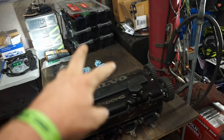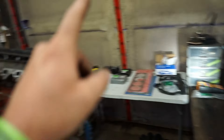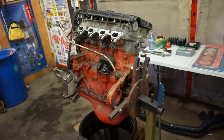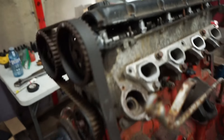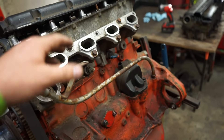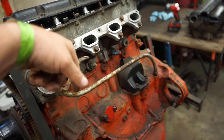I also want to check out the bottom end. I bought these motors as a pair and one of them was locked up solid; this one still turns over fine and seems to have decent compression. I want to check the cylinder walls, check the bearings, and everything else when I swap them. Also going to swap cams - this has the car cams and this has the marine cams - so we're going to put that head on that block and those cams into that head. Simple - just a cylinder head R&R and a once-over with new gaskets. I've never done a 16V belt so I want to try one.